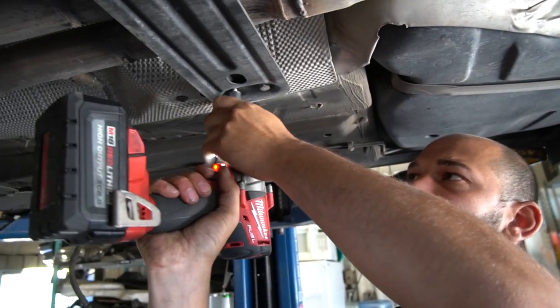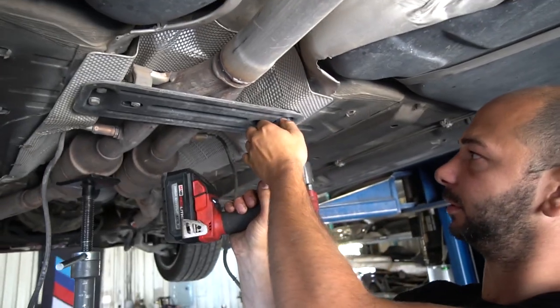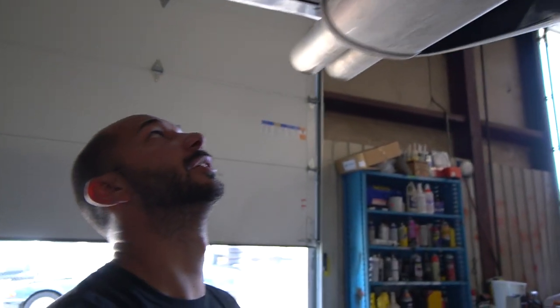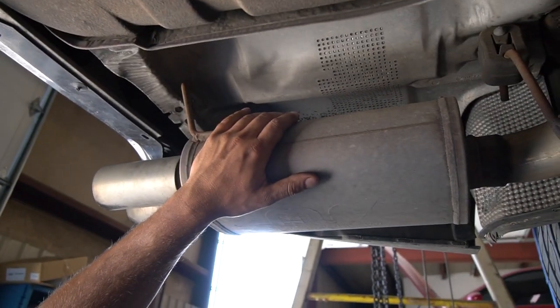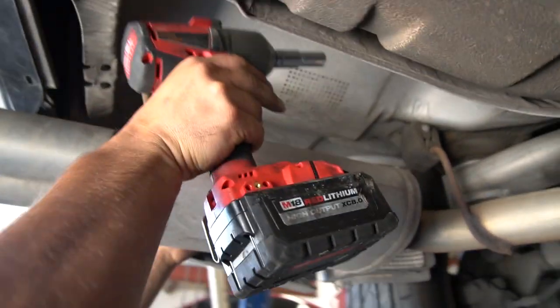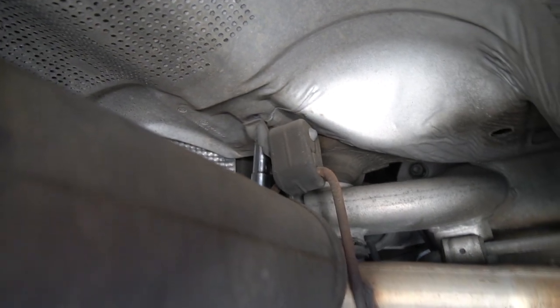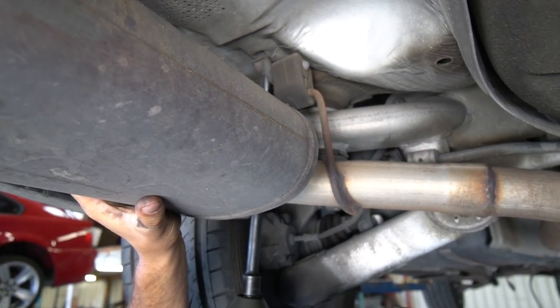You're going to leave this part of the O2 sensor on the exhaust. Then you've got this center mounting brace here — it's four 13mm bolts. Moving to the back: this one is a slightly different setup because of the aftermarket muffler that's been added, but a factory car would regularly have a muffler that almost fills up this entire area. That's all that holds up the exhaust.